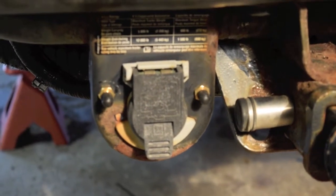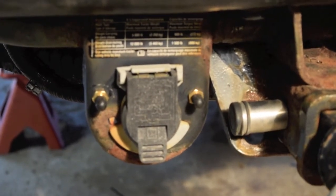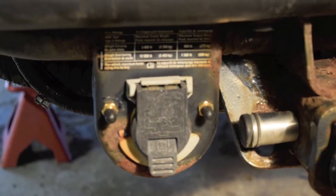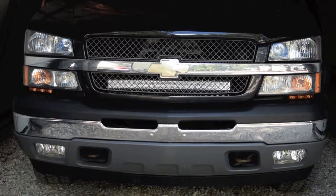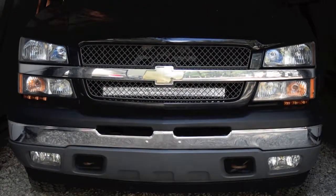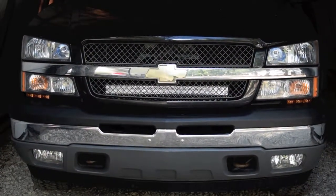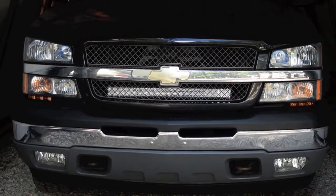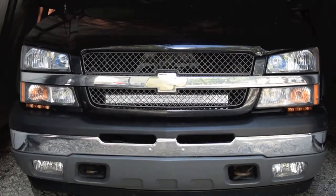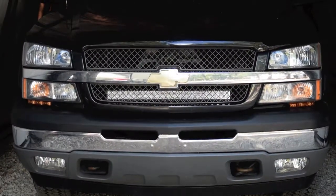We'll report at the end whether at 5 PSI it brought the rear bumper up off the ground. I pumped the bags up to 40 PSI just for a test and they moved the rear bumper level from 20 inches to 23 and a half inches. I brought the PSI back down to 10, which is where I'm going to leave it, and that moved the bumper height from 20 inches up to 21 and about a quarter inches. That's it — all installed.